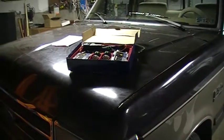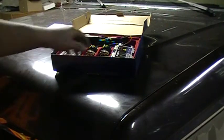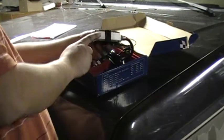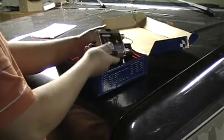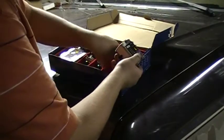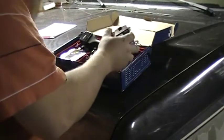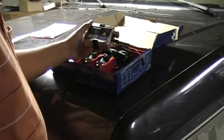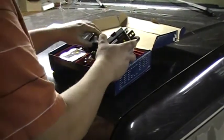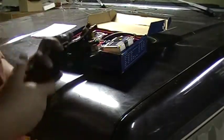First off, you're going to want to skip the digital slim ballast. You'll see a lot of times people advertise digital slim, which means this is your ballast, by the way. It's about half the size of this, and it's mainly in a plastic case. They're supposed to not be as good as these, so sometimes bigger is better, and in this case, it seems that way. These are basically what fires your bulbs.